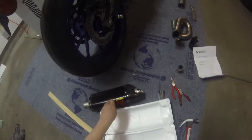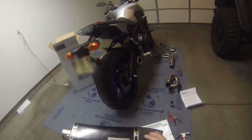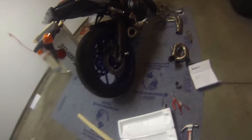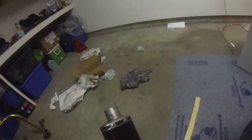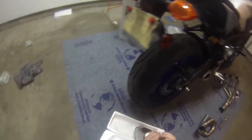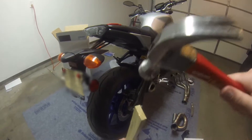This DB killer is like the biggest pain in the ass to get out. But I found a nifty little trick. The little four millimeter bolt is behind this little cover right here, and it's held in by friction. You can try to muster it out using pliers, but what I did was I went and got a wooden dowel from Lowe's — something small that can stick in there and slides right in, going onto the back of that little lip inside. I put it on a piece of styrofoam so it's not being dented into the ground, and then just give it a hit.